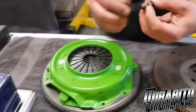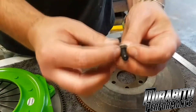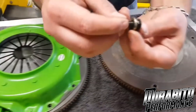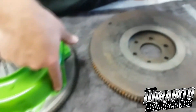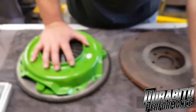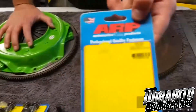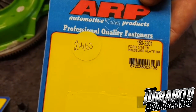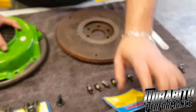You can get other bolts from a normal bolt shop but they'd just have thread all the way up, which is a little bit sloppy. You can see that shank does open up a little fatter and that locks in real nicely. I'll show you the part number again — that's exactly what I use. You can go in and ask for them, go on eBay, or Hemic Performance probably has them — then you're set.